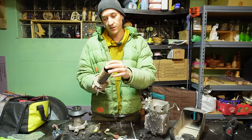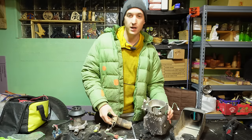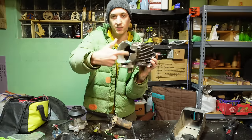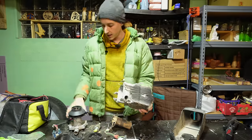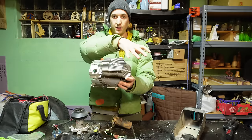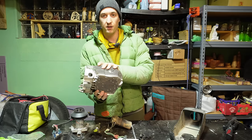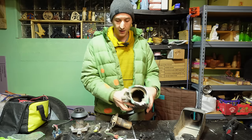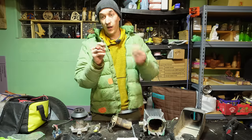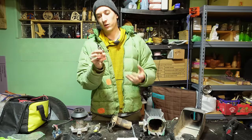And then the exhaust gases come out of the end of the burner. There's a lot of radiant heat that comes off of this too, and that goes through the heat exchanger. The heat exchanger has fins on the inside and fins on the outside. And remember that this blower fan is also forcing air over the heat exchanger. So that's how you get a clean, dry heat free of exhaust gases. And then when you turn off your heater, everything ramps down and the glow plug lights up again after fuel is long gone. That's just to keep the glow plug clean.